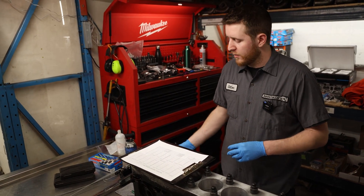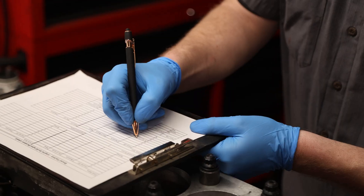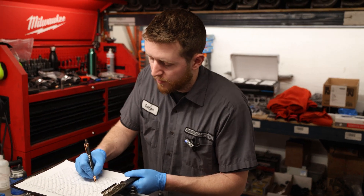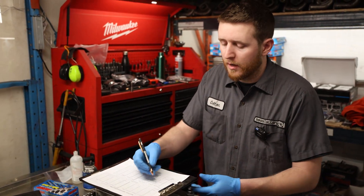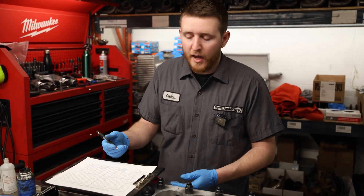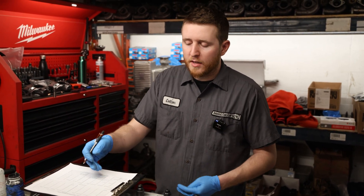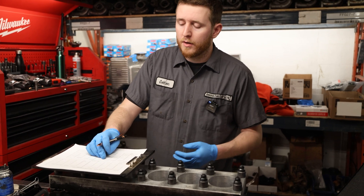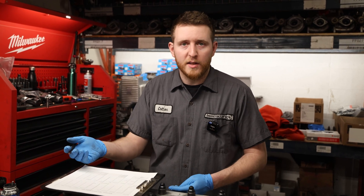Now that we've measured our piston OD for cylinder number five and our clearance, I'm going to record the size of the piston — 3.4023 inches — and our clearance was 0.0035. This is the point where I go back and repeat the steps for all the pistons, record all clearances, and then record the out-of-round and taper for each cylinder bore. I make sure every measurement on the block is accurate to each cylinder. The reason I do this: if there's ever any issue and you need to come back, you'll be able to see if something was out of round a little more than the rest — that could be a sign of an issue. Mostly it's for my own peace of mind so I know exactly what I measured and have it written down.